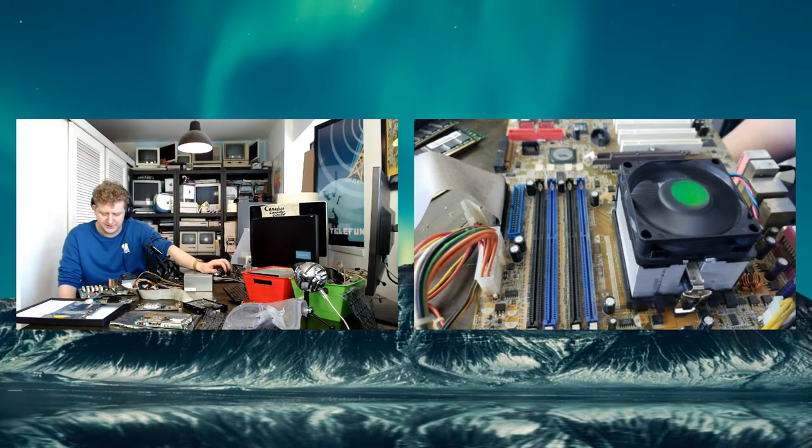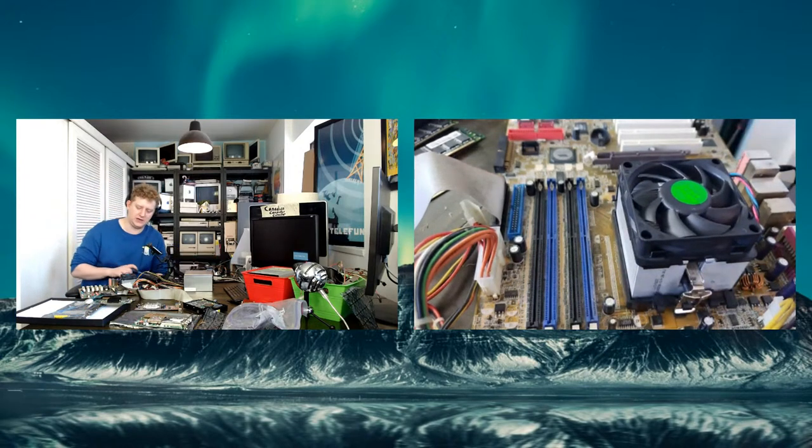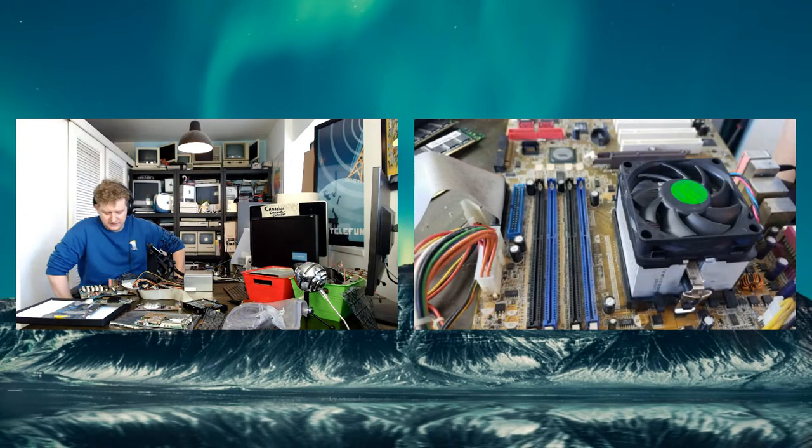Well, I'm kind of at a loss. I'm wondering if maybe Garth is onto something here by saying that perhaps the CPU is dead, because we're getting nothing here. I mean, we got power coming on the board for sure. Obviously, there's power to the fan for the cooler. But no beeps, no video, no matter what. And we tried four different video cards. So, you know.